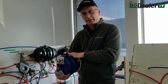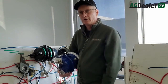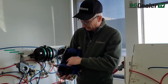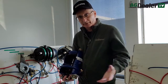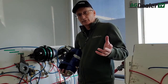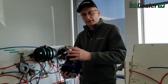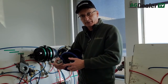If you're wondering why these are called Type 30s and fronts are called Type 20s — and there are others out there, Type 44s, all kinds — the type number indicates the amount of square inches of area on the diaphragm. So a Type 30 has 30 square inches of diaphragm, Type 20 has 20, and so on. So if you imagine a truck with 100 pounds of air pressure in the system making a full application on a Type 30, that's 100 psi times 30 square inches — that's 3,000 pounds of force coming out on the push rod.